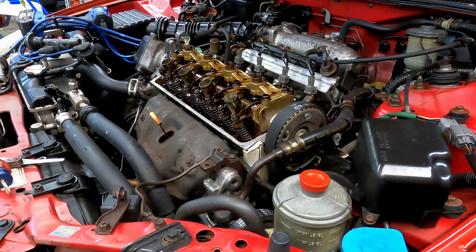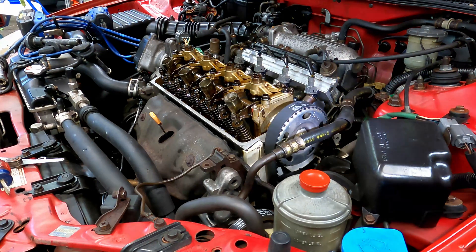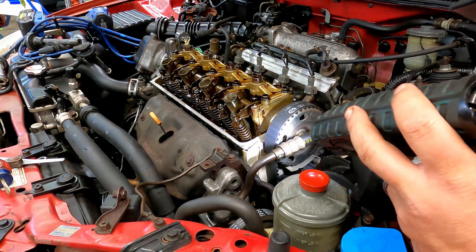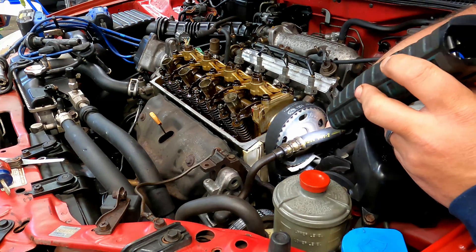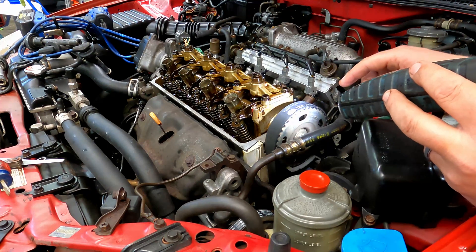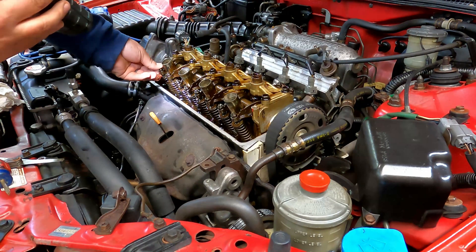Once I get close I'll use the visual reference up here. Alright, that's good — we have this line back on both sides, our reference marks lined up with the plane at the top of our head where our valve cover sits. Since we just did number one, now we have number four on top on this side. So we come over here and do all four valves on number four cylinder, which is on the passenger side of the vehicle.